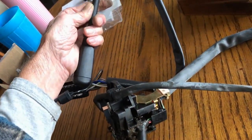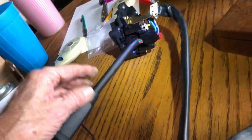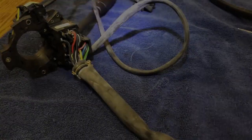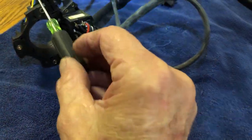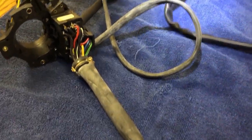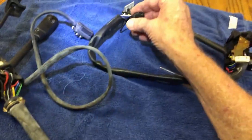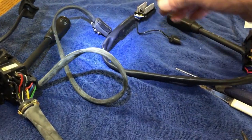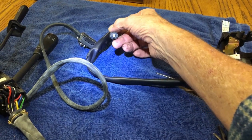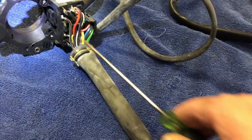It goes like that. Cruise control right here. Good God. Yeah, I'm going to have to open a cold one and look at this thing. Alrighty. Okay, so we've got to switch some stuff over. This is the cruise control on the old one, and we have to put it on the new one. Oh, by the way, this plug right here is for, let's see, mine doesn't have it, yours might not. This is for the station wagon rear wiper washer pump. So just leave that disconnected or cover it with tape if you want. So this one, let's see.